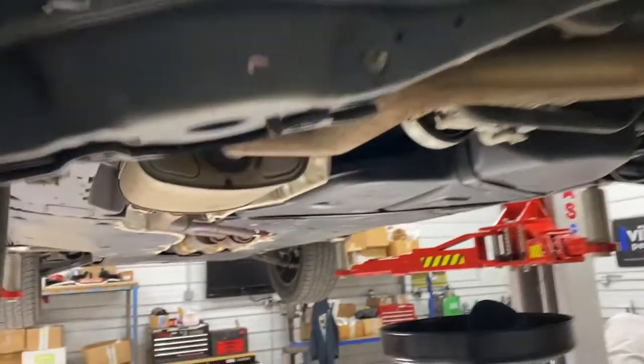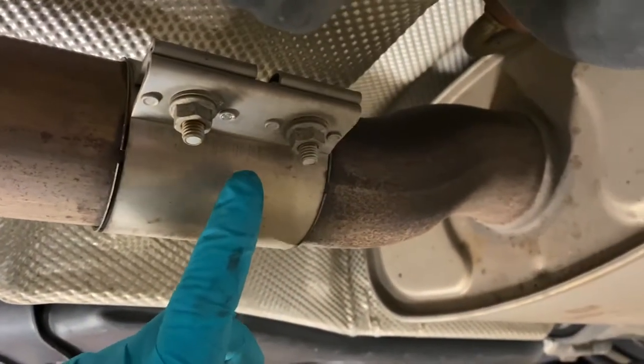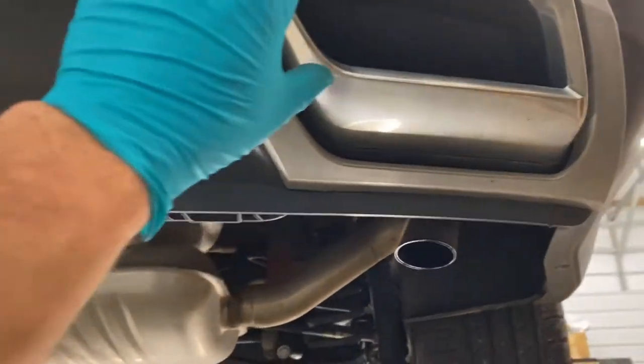Just did some measuring. It starts out with dual 55mm at the downpipe - it's not really a downpipe, it's not turbo. At this connection it is 70mm, which in America isn't a common size. Thanks Volkswagen for that. And then it comes back to dual 60mm - not real tips, because they fake the tips. So I might explore removing those and putting real tips on it.